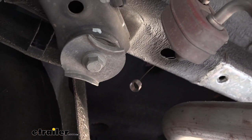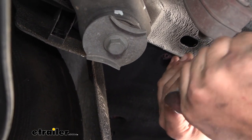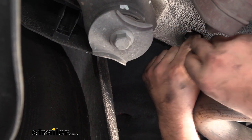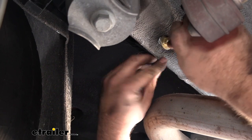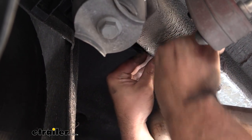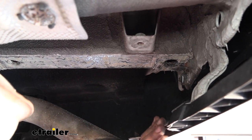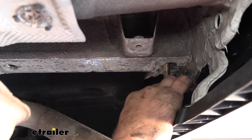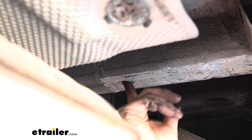On the coiled end, take your carriage bolt and spacer block and get them fed onto the coiled end. Feed each one in one by one — push the spacer block up into the frame rail, then the carriage bolt. It might get a little tight so put it in at an angle; sometimes it's easier to put the head in first. Feed the carriage bolt up, then pull on the end where you fed it in, jostle it around, and the stud should pop through. Keep your fish wire attached — it makes it easier to hold the stud in place when you push the hitch up so it doesn't push back into the frame. Repeat the same process for the other hole and the other side of the vehicle.